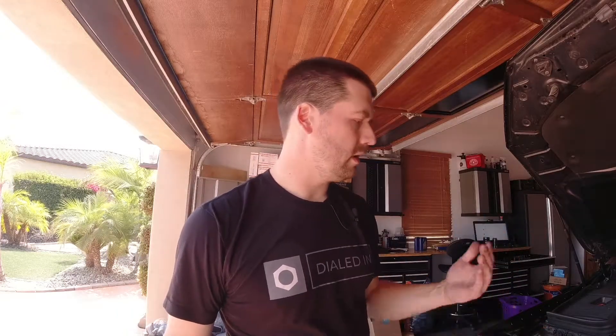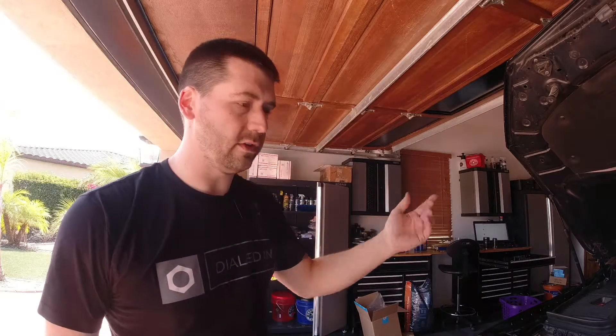At this point I've done my physical inspection, verified all lights work, changed the oil, and changed the air filters — both the cabin air filter and the engine air filter. They recommend changing the engine air filter at 50,000 miles, which I think is a little too long, so I just did it now for 50 bucks. Taking this to the dealership for an A service is supposed to be $299 — usually $249 with a coupon. I'm into it for $140 with those extra filters replaced. I bought seven quarts of oil; it only took five to fill it up, so you have two quarts left over.